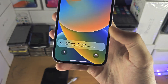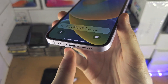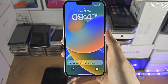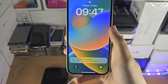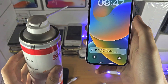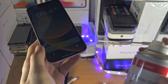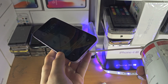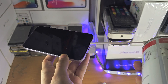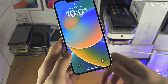Welcome everyone. The first reason why you get this message is because the charging port is dirty, so the cable isn't going in all the way. To clean your charging port, you have a couple of options. I have compressed gas — if you have it, just place the nozzle and do a little squirt around the edges, then leave it for about a minute for the gas to evaporate.